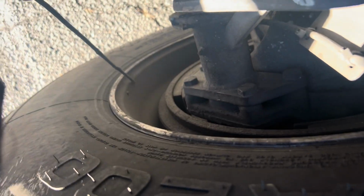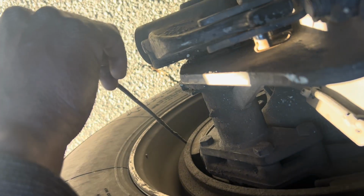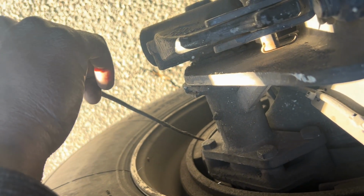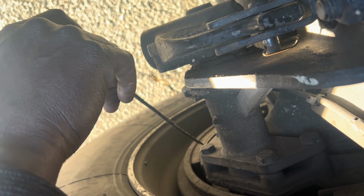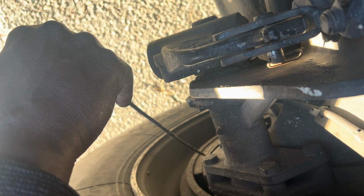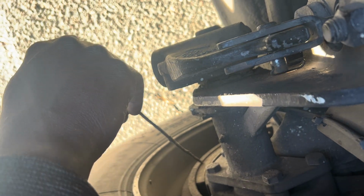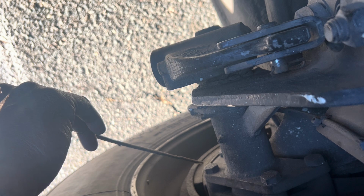Then I come here, I'll check my brake drum and my brake pad. Come here, let me show them. Yeah. That's my brake drum. This is the brake drum and my brake pad. Mounted and secured to the vehicle, no bend, broken, no crack. My brake pad is not flat like a penny. Make sure it's not flat like a penny or like a 1 cent. Okay. And then there is no oil or grease contaminate between my brake pad and my brake drum.